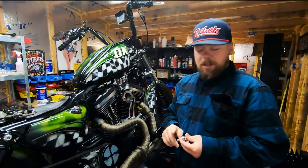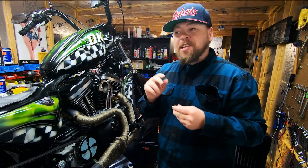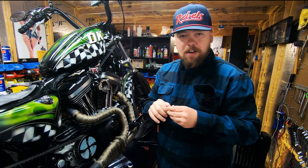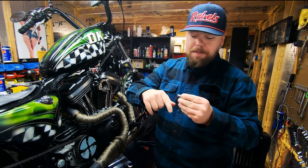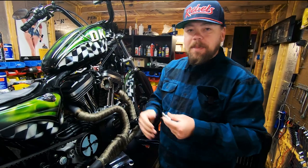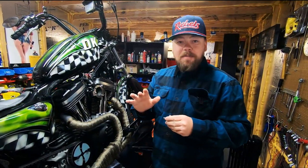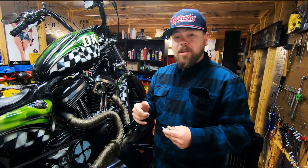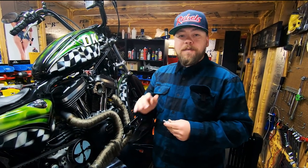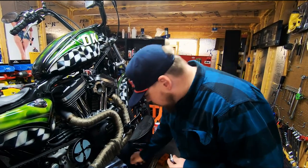The factory breather bolts have a white paste — that's Teflon paste. It acts as a thread locker and prevents seepage where oil carryover may seep around the threads and leak out. I prefer Teflon tape, which works perfectly. It stands up to heat, acts as a thread locker, absolutely prevents seepage, and is much easier to find — most times we have it laying around the house.